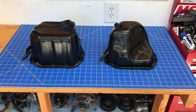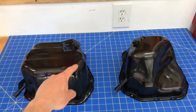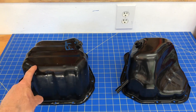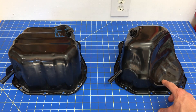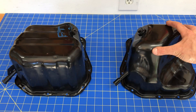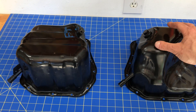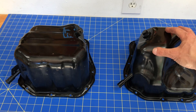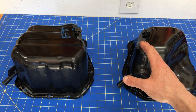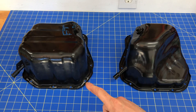I'm gonna start by doing an overview of what these oil pans look like from the outside. This oil pan here on my left is the older style — it has a much wider base, which allows a lot more oil to accumulate on the bottom in a much broader, wider area. This newer style oil pan here on the right has a completely different design. It's got this whole kicked-in section which creates a much narrower but slightly deeper area for that oil to accumulate. That deeper narrower channel means there's actually less chance for the pickup to suck up air when oil gets pushed to the side. That's one of the fundamental differences between this newer style oil pan and that older style oil pan.